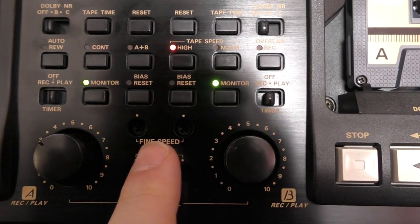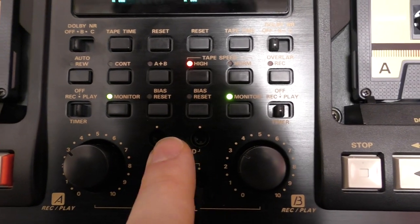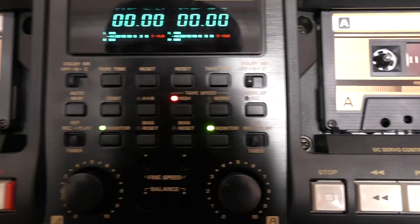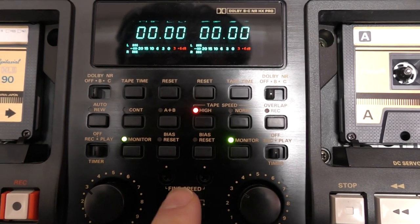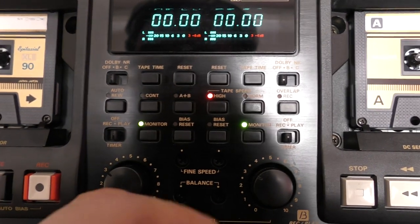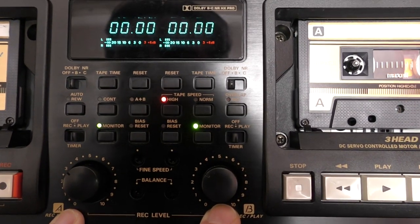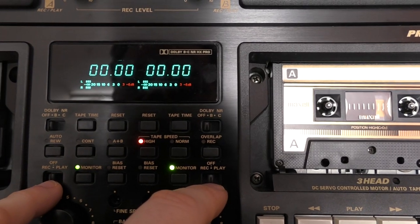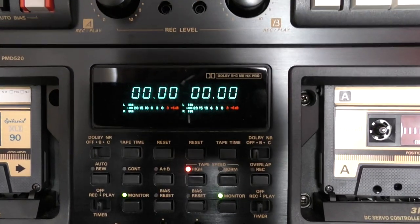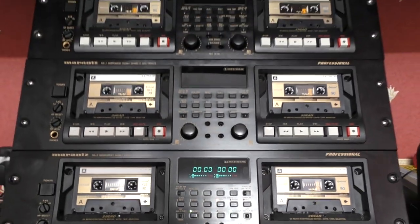At the front we've got two little holes for fine speed adjustment — you put your calibration tape in, listen to it, and if it's a little out, just shove a screwdriver in and tweak the speed. I only had to do minimal adjustment when I got these because they were brand new and stored well. There's also a balance adjustment on the front if a tape isn't quite balanced right. You've got master inputs, the rec level is settable independently for each deck, and there's timed record and play. My only complaints are that the VU meters aren't accurate enough for me, and there's no indication of which cassette type has been recognised.